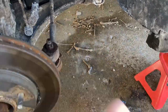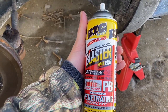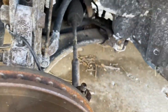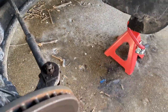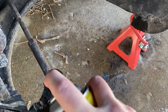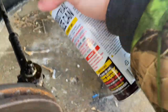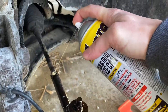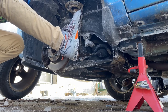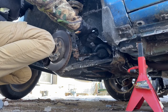What we're going to do next — not sponsored — but we're going to get this big shot of PB Blaster and we're going to spray it right on that nut. Don't get this in your eyes or anything, and don't get it on the brake pads or whatever. Just do a straight shot. If you can't aim, get closer. That ought to do her. There you go, on that bastard.